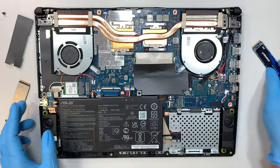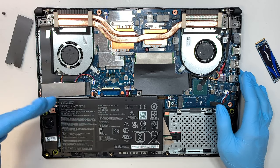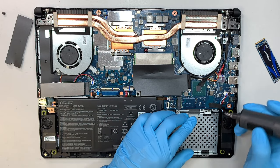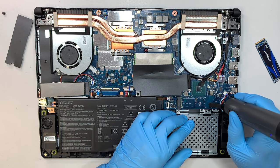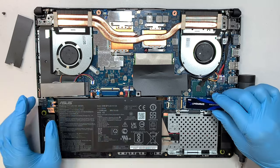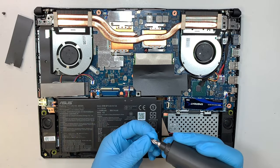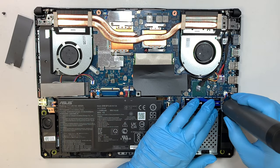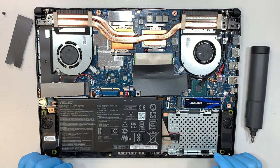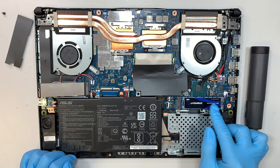In this laptop there are two slots. The second slot is at the bottom right corner. Get your Phillips screwdriver and remove that screw — do not lose it. Slide in your NVMe M.2 at a 45-degree angle to the left, then go ahead and tighten up the screw you just removed. Now the computer will have two NVMe M.2 SSD drives.